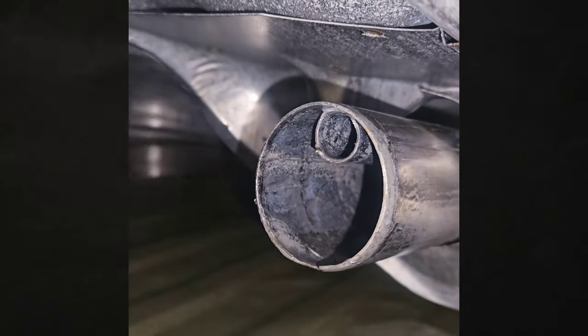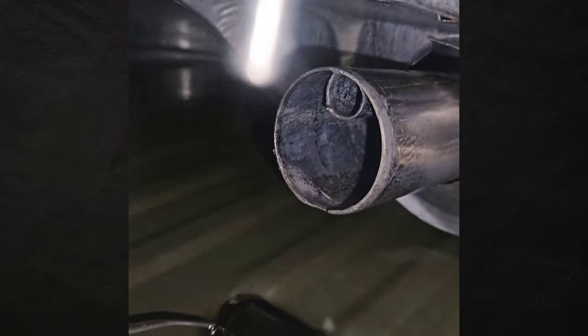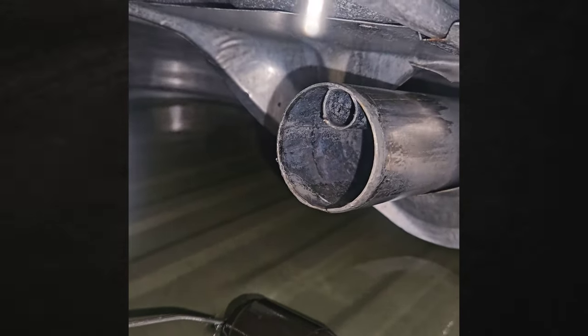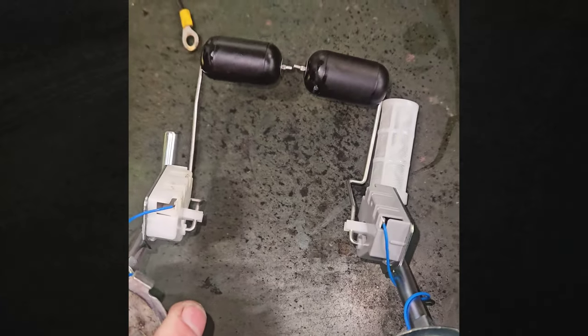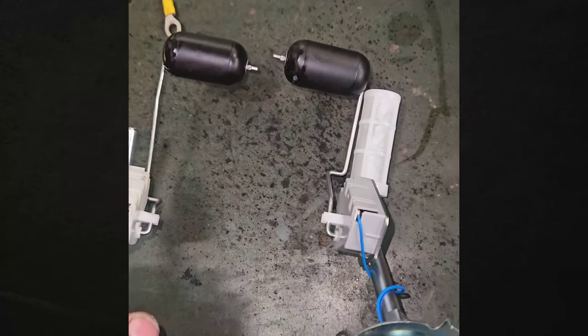And we're gonna take a look down in the fuel tank, and there's the float, and look what's right above it. The filler pipe. So at half a tank, it hits the filler pipe and it won't read any higher than half a tank. I decide to order another one, and I place the order, and same part number, everything. Do you see something wrong there?